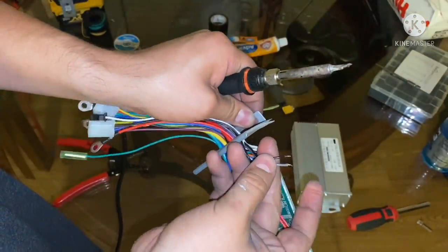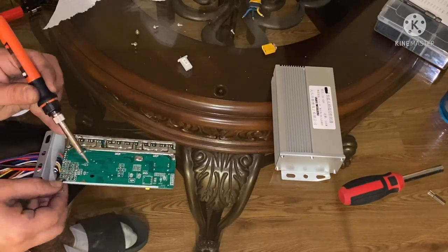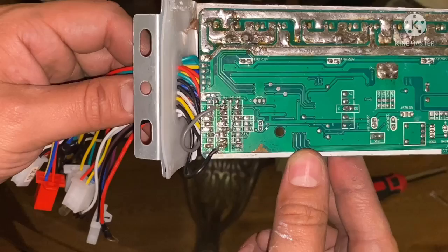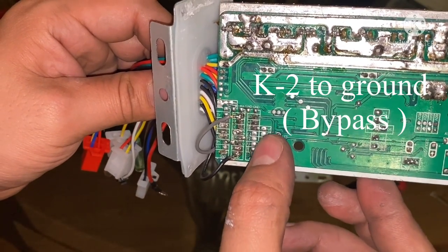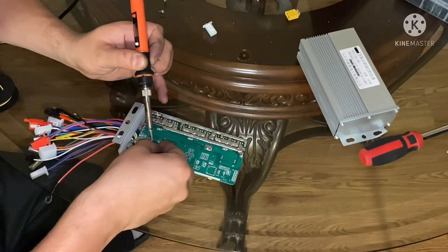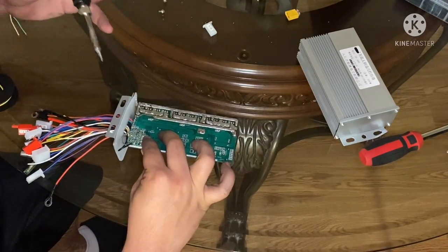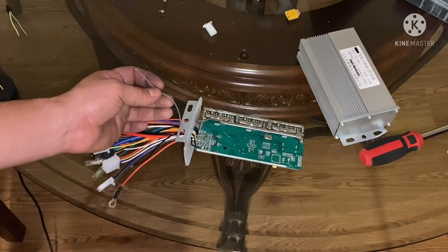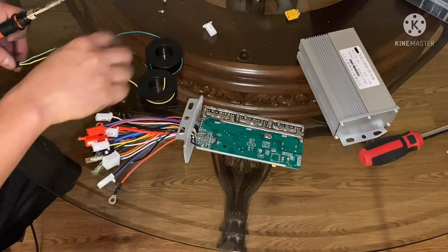I've got them out — add my black to my ground and my gray wire to my five volt. Here goes my five volt supply from the headlight: black is ground, and my gray wire is going to be my five volt. While I'm here, I'm going to do my bypass — K to the ground — so that my third speed will stay activated. Let's go ahead and do that K-to-ground bypass. My black is ground, my gray is five volt. I'm going to solder my two spools on this end, measure my length, and go from there: green to green, then yellow to yellow.